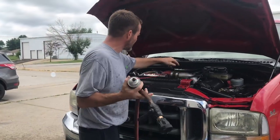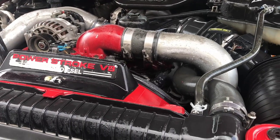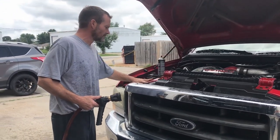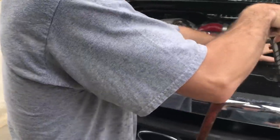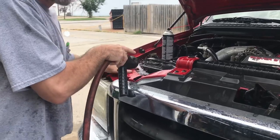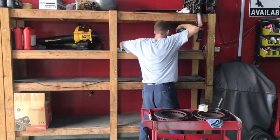We're done with this for now. I don't want to get too carried away. I'm not going to hit this area because I don't want to take a chance on that grease coming off and going down on the belt — if you brake clean this right here you will squeak the belt. So I use water only and then actually wash the belt off. I've been burnt about as many times as I've been saved by doing that. But I just can't stand to let the truck sit there and look withered away. If it comes to the shop and we're gonna take the time to work on it, why not? We're not in that big of a hurry. Anthony's over here getting a spot ready for parts we're about to take off.